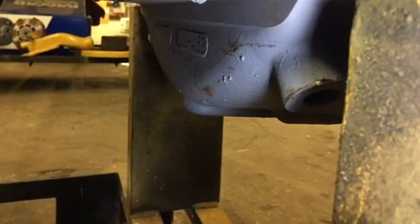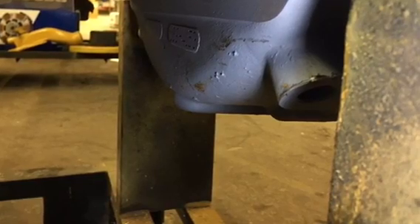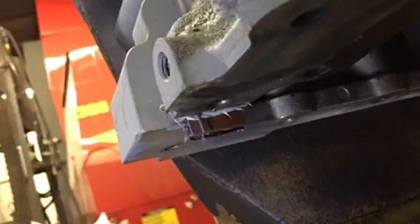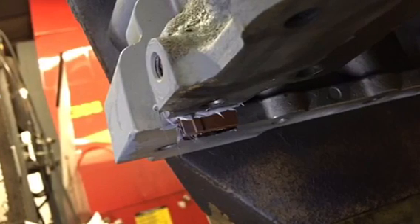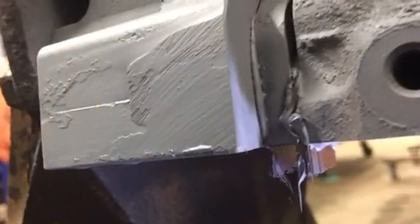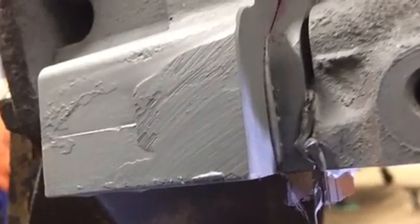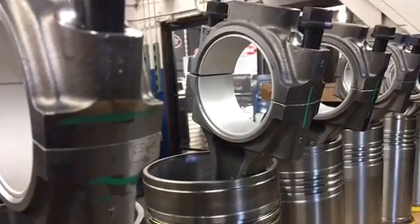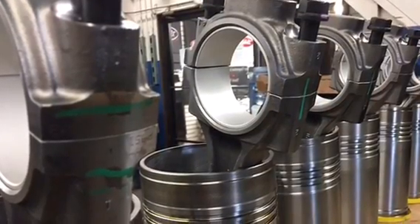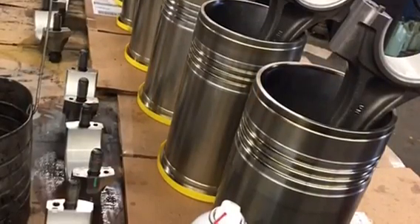Here I was trying to get some pictures of the front and rear structure where I glued from about the bottom bolt hole down. On the gasket surfaces I used gray silicone. There's the excess gasket hanging out — you just trim that off. I always want no gaps in the gasket where your pan, your block, and your rear structure all meet up.